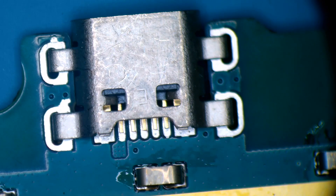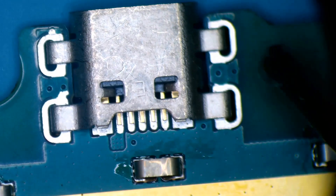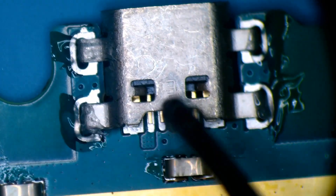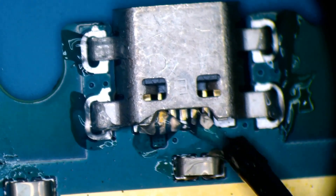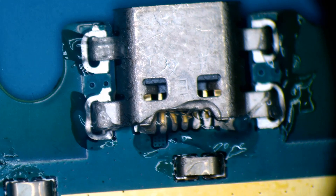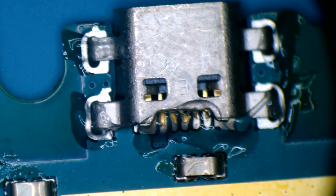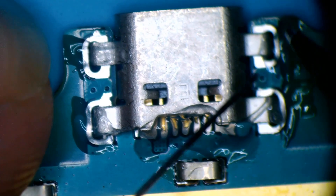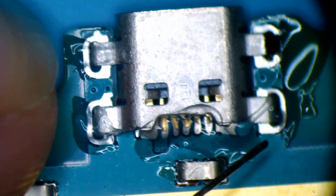This is the new charging port. What we're going to do right here is apply some flux first on every leg of this charging port — what holds it to the motherboard. This is very important because we're going to secure this very well, so the charging port doesn't fall apart when people plug in and plug off their cords. We're going to apply flux also in the middle where the pins make contact to the motherboard, and then apply some solder with our soldering iron.